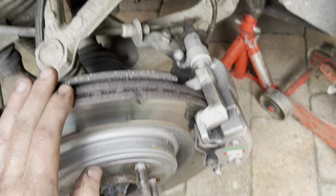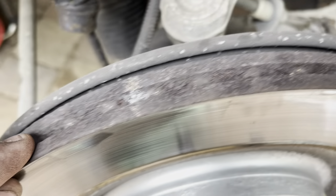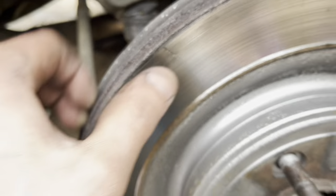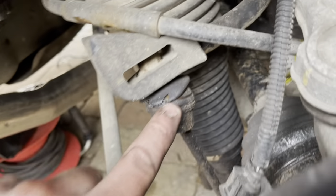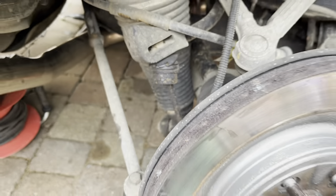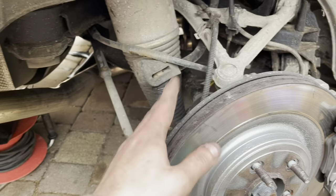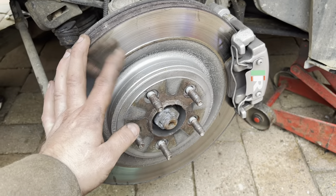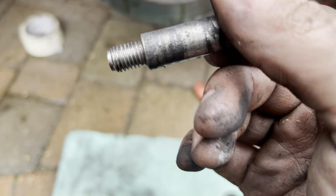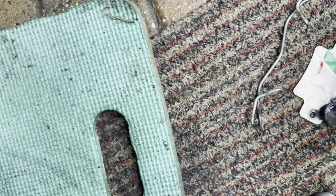In this video, we're going to try and capture the bits I missed in the last video. The pads are quite low, and the discs are old — they're not gone, but they're old. You've got that rough edge. Well, that drop link is gone as well — that was a new one. They're absolute rubbish, I'm going to have to get two new ones of them. Anyway, we'll do that in another video. That slider was hard to get out, but I've cleaned the other ones on the other side. I'll clean these and copper grease them and put them back in again.